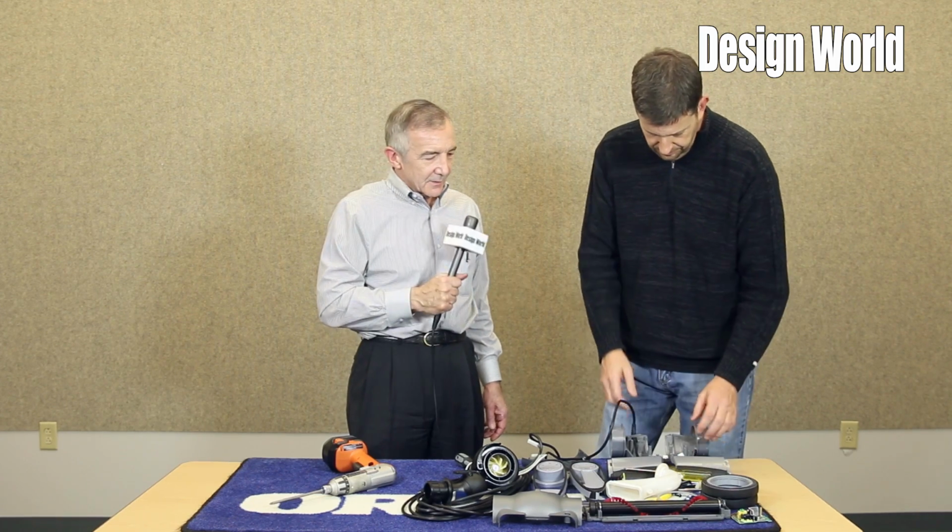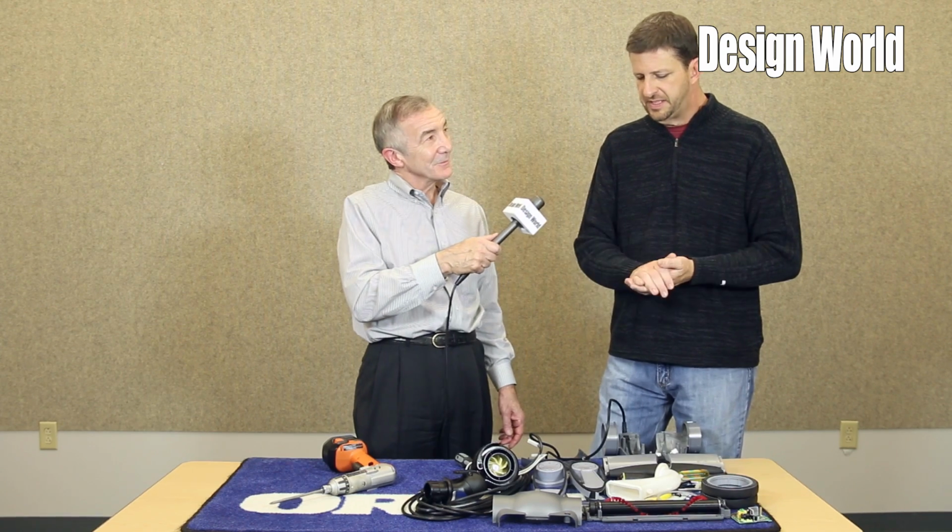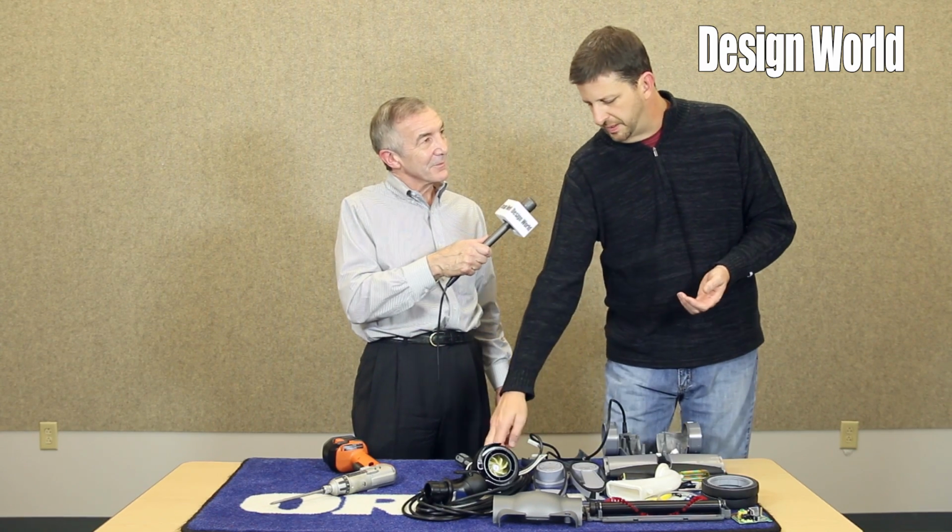Okay. And the belt, there's no gear ratio on the belt. I mean, the pickup unit's running as fast as the motor is turning. There's a ratio, but it's just controlled by the shaft diameters. So that's how we control the speed of the brush roll in relation to the speed of the motor.